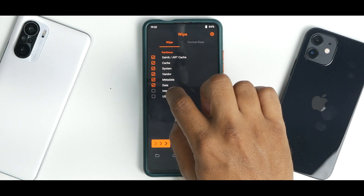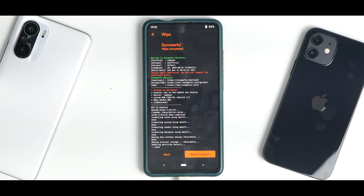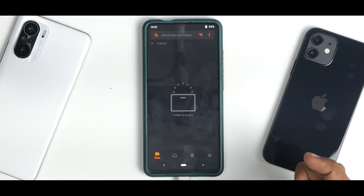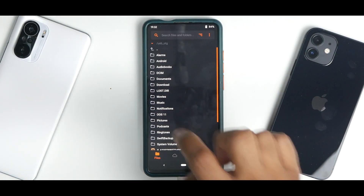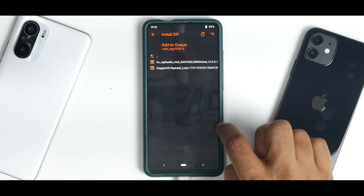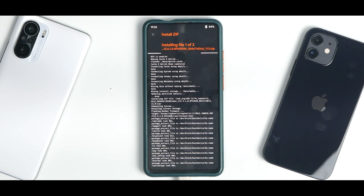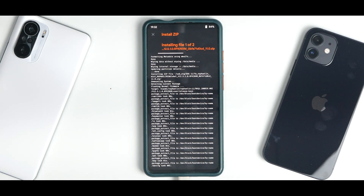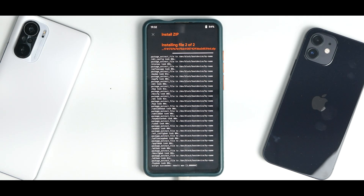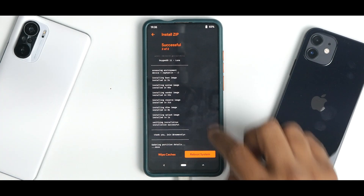Remember, there are a lot of things to do in sequence, so please follow this video step by step and do not skip anything. Now we are in Orange Fox Recovery. The first thing to do is go to Wipe — Dalvik cache, system, vendor, metadata, and data. You can wipe internal storage too; it's completely up to you. I have my files on the OTG pen drive so I'm going to wipe everything. Once everything is wiped, select the OTG pen drive — the OS 11 folder is where the files are stored. Flash the firmware first, add to queue, then the ROM itself, and swipe to confirm flash.